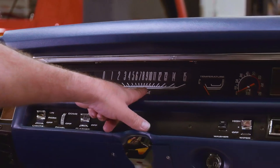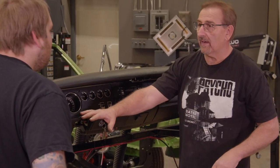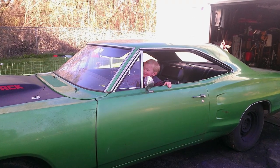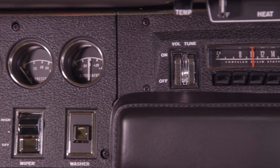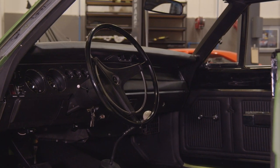I love sending our stuff to Instrument Specialties because when it comes back it looks the way it did when brand new, and they're not aftermarket replacement parts. If you just look at the gauges, that's the original mileage right there — the owner opted not to switch it back to zero. When his dad last drove the car, that was the mileage, and I think that's such a great tribute to his father. They didn't put decals on the faces like some people do — they actually did the photochemical process. It's a masterpiece. We also restored the steering column using nitrocellulose lacquer so it had the same sheen as the Instrument Specialties paint on the dash — the way they were from the factory. The original code was called jewel black or black jewel.